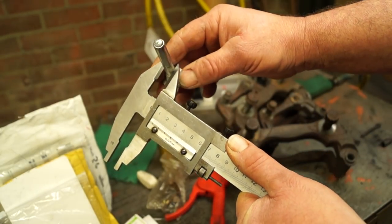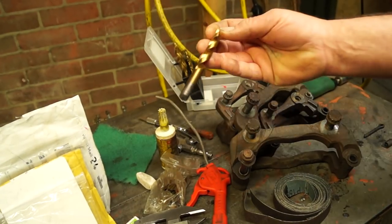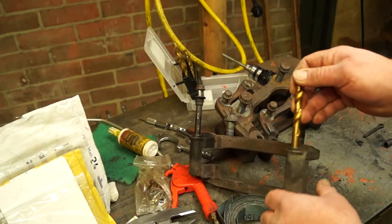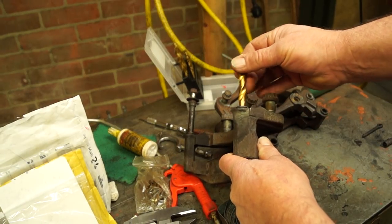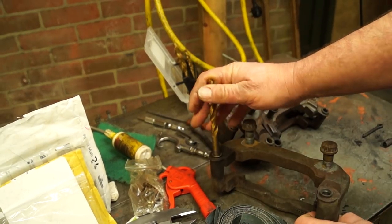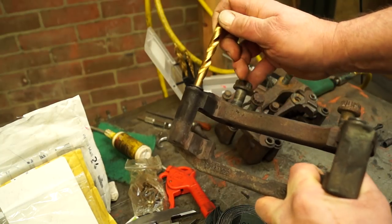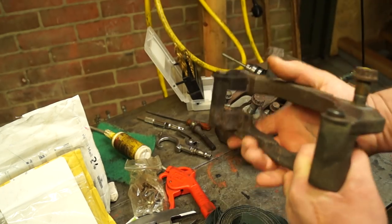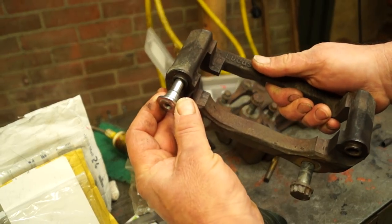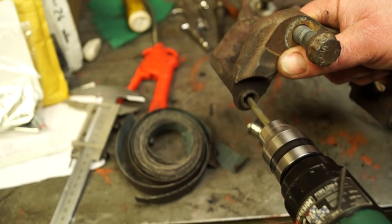The pins measure out at 9.95 millimeters. I have a 10mm drill here — I use this drill set just for gauging. If a 10mm drill fits in and moves fairly smoothly, that's okay. On a Freelander there'll be rubber bushes in there, but this is steel to steel, which of course is more prone to corrosion. This end is very tight; this one's actually quite loose — it's better loose than tight.